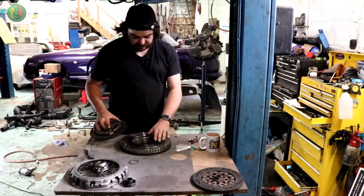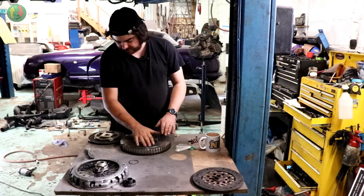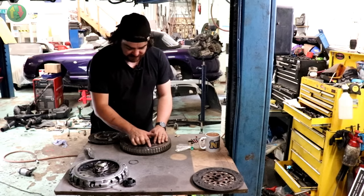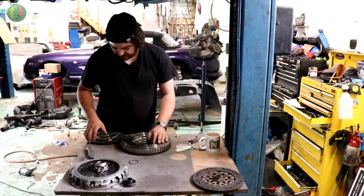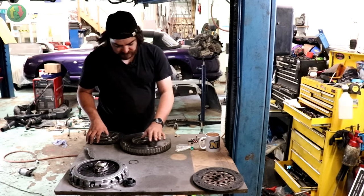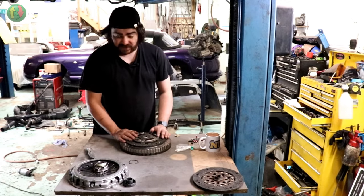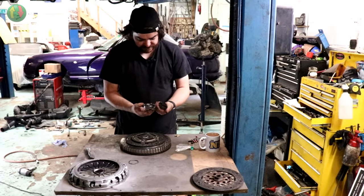The flywheel does have a raised surface with a little lip. Incidentally, if you have a TVR Cerbera and get the flywheel refaced and they remove that tiny lip - on a Cerbera it's even smaller, about a quarter of a millimetre - the clutch will drag and you'll have to take it all apart again and get the lip put back in.